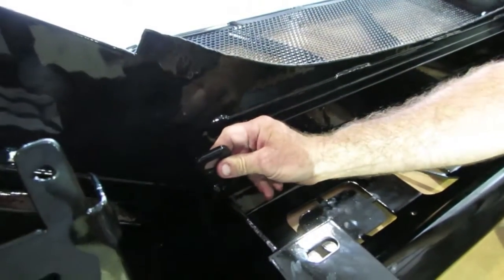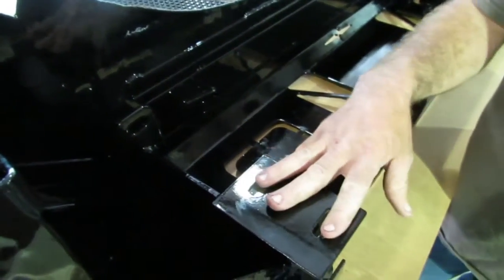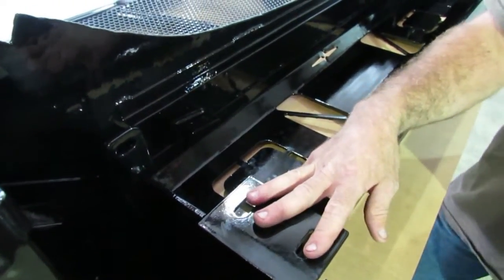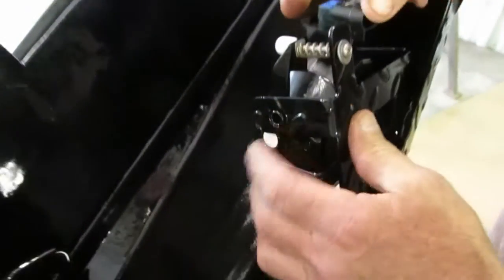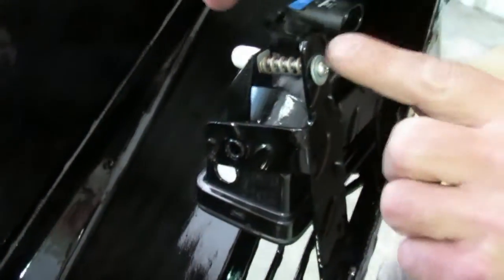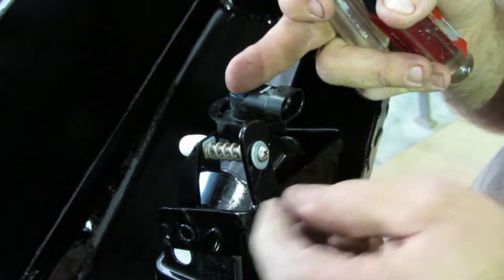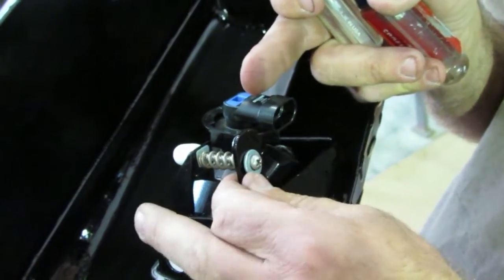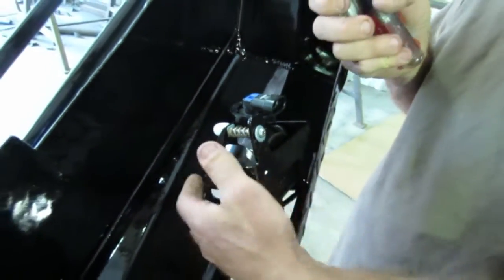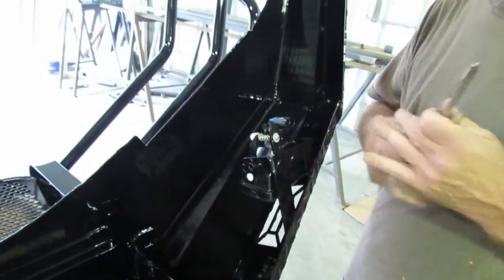This little tab here is where your upper mounting bracket is going to go. And this is where your bottom mounting bracket is going to mount to. Here you can see the fog light bracket without the light in it, and over here we've mounted the other side. These are the little plastic dowels you've got to get out of that other one. This is your adjuster screw that you're going to reuse — put your spring back in there, your screw back in, and we supply this little washer so your screw doesn't go through the hole in the bracket. It's a lot easier if you put the lights in before you put the front end on so you don't have to get up underneath there to do that.